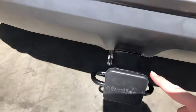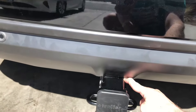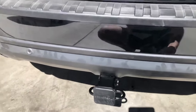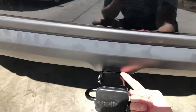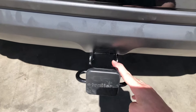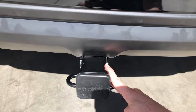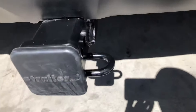The instructions differed in some of the measurements for cutting. It says to do about two and a half inches from the edge up, but because this bumper is different, I almost had to go an extra inch or two. Luckily I was able to use my rotary tool to get in behind it without taking the whole hitch off, because I didn't notice it until after it was all the way in. It's a bear to get this thing in, so let's go underneath — pardon the movements as I get under.